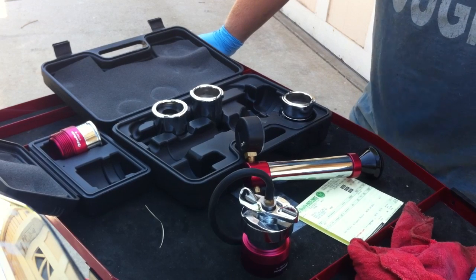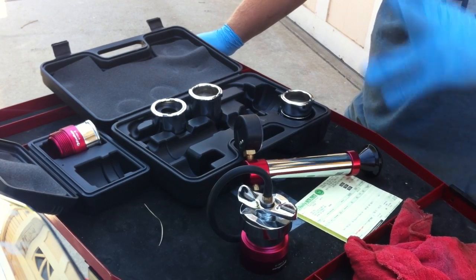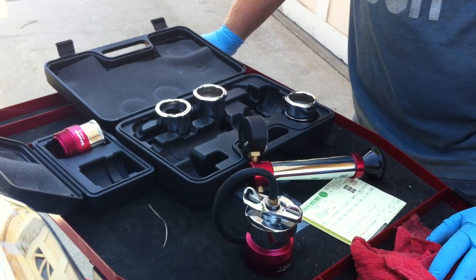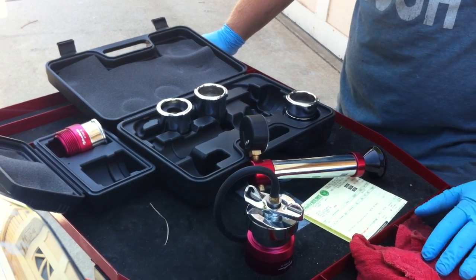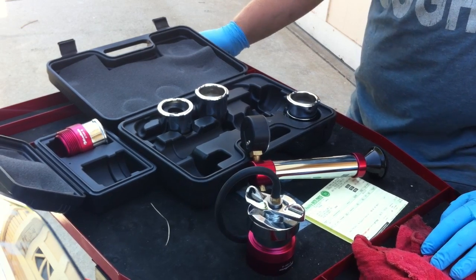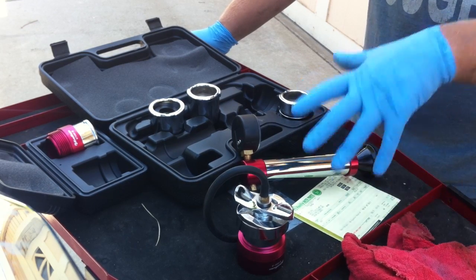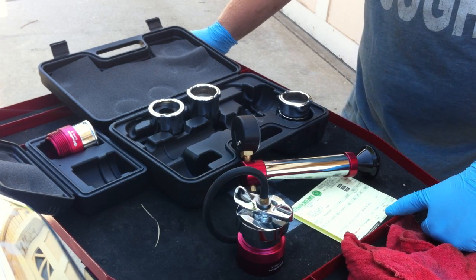That's really it. I couldn't show you any leaks because I didn't have any, but that's what you have to do. It's very similar to boost leaks because all you're doing is creating a pressurized system, just like the boost system. The system is wet because obviously it has coolant, so all you have to do is go around and look for bubbles. If not bubbles, you'll hear air hissing. Cooling system pressure leaks can cause all kinds of problems — coolant loss, engine performance issues, high temperatures — all caused by the cooling system not maintaining its pressure properly. If you think you have a leak, get one of these and check it out. I'm going to go take this one back, get my $200 deposit back — no leaks and I'm out no money, so it's a pretty good deal.